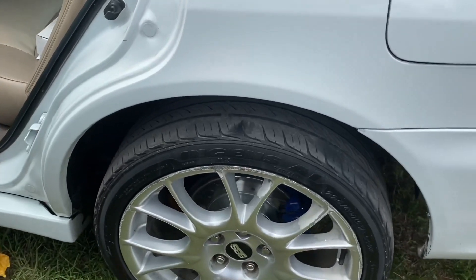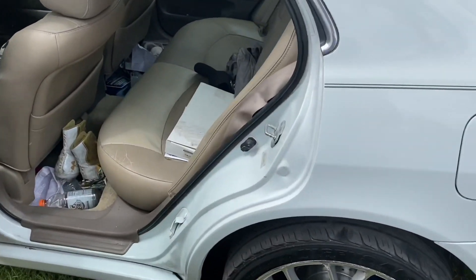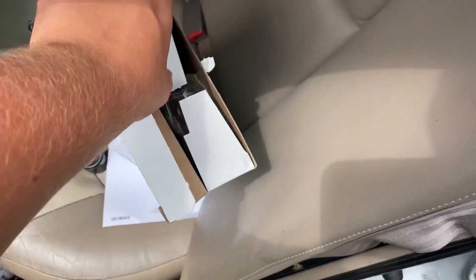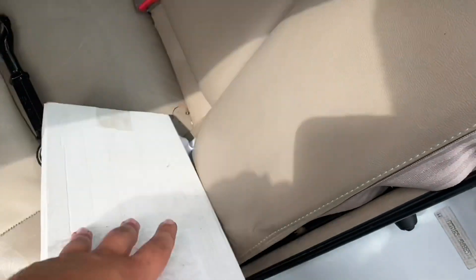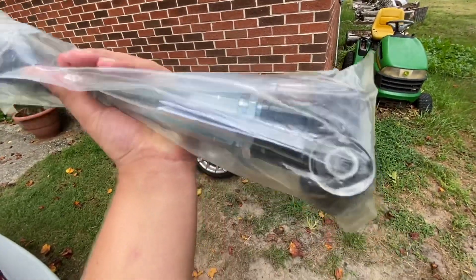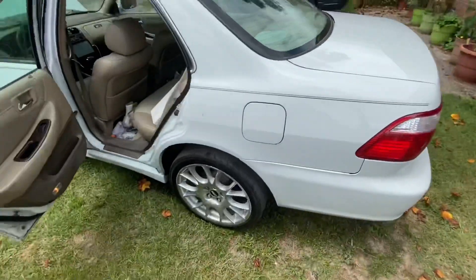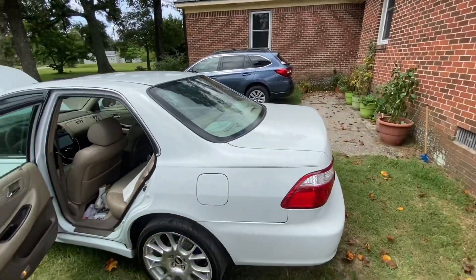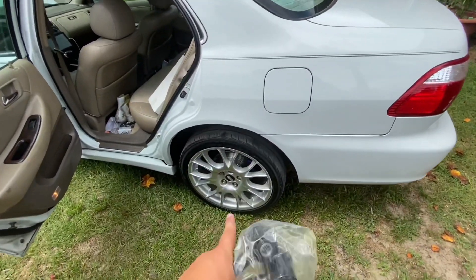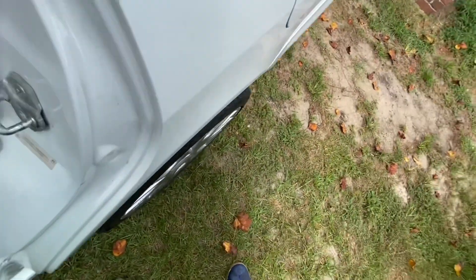Getting back into this rear suspension, I recently bought another camber arm and some more fully adjustable control arms. These are Moog control arms — these are fully adjustable, they adjust in the middle here. I actually have a video on putting them on the other side, so if you want to see that video it's going to be in the playlist down below. But now I have to put some on this side, which means I can have full camber and toe adjustment.